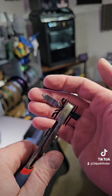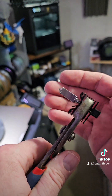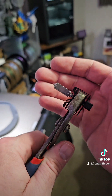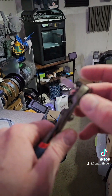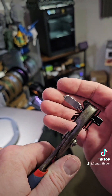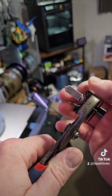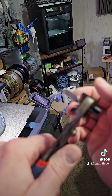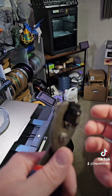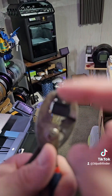Probably what it was, was I went from PLA to PETG, and the PLA typically runs at a much cooler temperature, but I'm betting that either I had some heat creep or a piece of that PLA got kind of slightly overcooked inside the nozzle and just got hard. And when the PETG was trying to feed in, it couldn't — there wasn't enough strength in the extruder of the Bambu Lab to push it out.